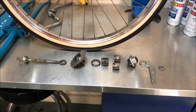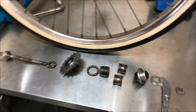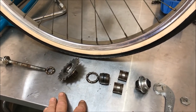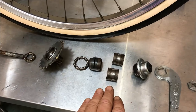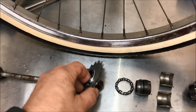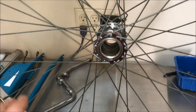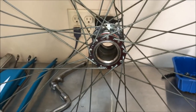This old-style bike system is pretty ingenious. Basically what you've got here is a clamping system. The braking part of the clamping system is just like the drum brakes on a car, and then you've got a clamping system that actually engages this gear socket against the hub, locking it in so that when you're pedaling forward you actually get power to the wheel.